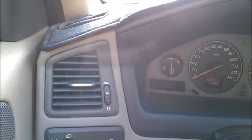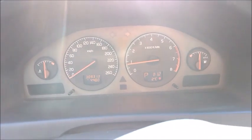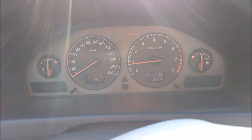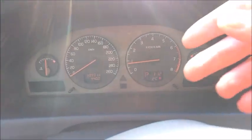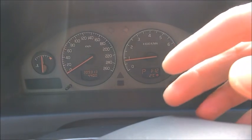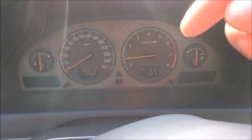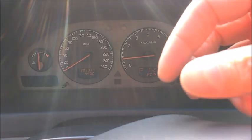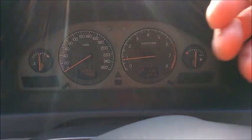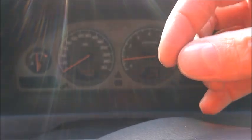So that's perfectly normal. One of the things that can cause the ABS light is what happened to me: once I pulled the suspension for some reason and pulled a little bit on the ABS sensor cable that sits on each wheel. Those cables are really, really fragile — they won't break or detach, they just shear inside right at the sensor.